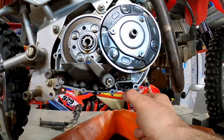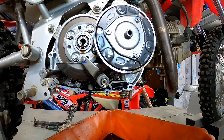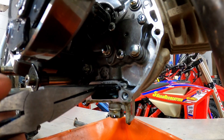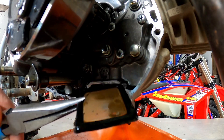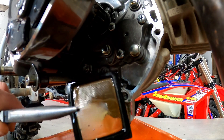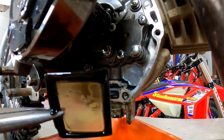And this is the little screen I was curious about — but look at all this gasket material in there. Let's get a pair of needle-nose pliers, grab a hold of this screen carefully, and just pull it straight out. Look at that — super clean! So if you're at home wondering if a 2015 is worth cleaning this screen, probably not — it came out really well.